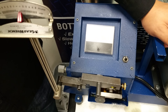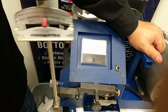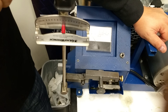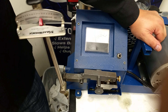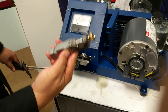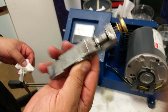We apply it to the bearing race — it's been reset — and as soon as I apply pressure it automatically stops. That race, that bearing, is going to get a lot of damage. As you can see, I cannot get it past 200 inch-pounds of pressure. It's not going to get any better. Now let's take a look at the damage — it's the same as with the conventional motor oil.